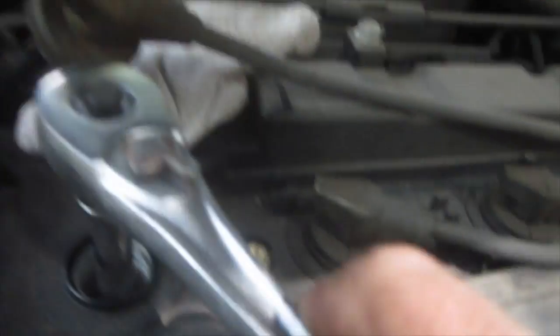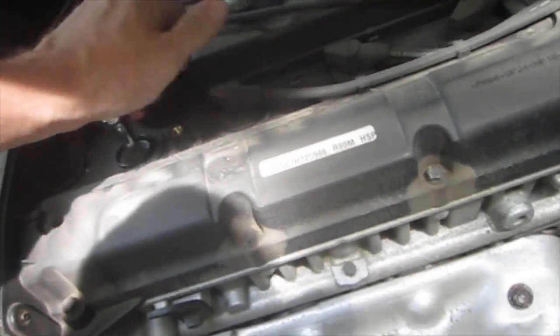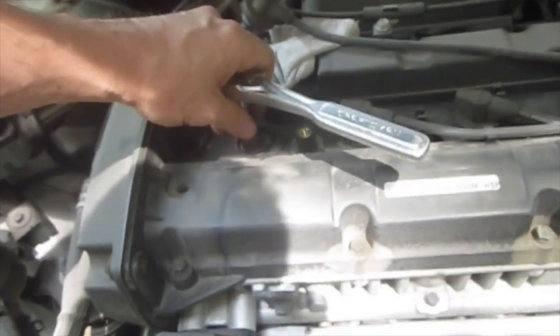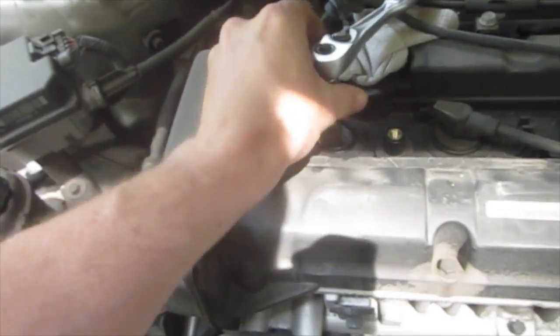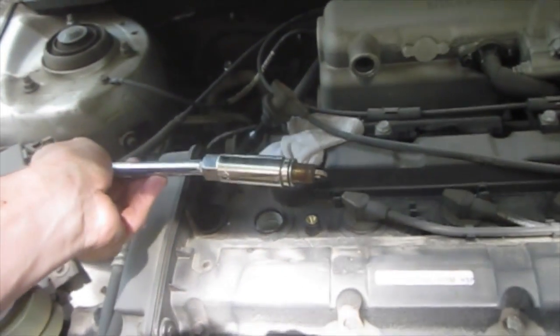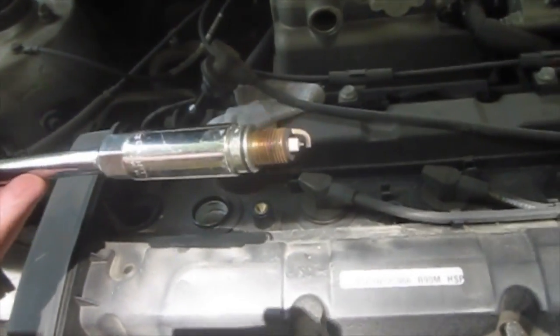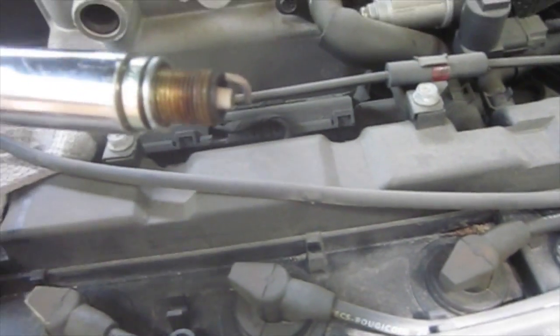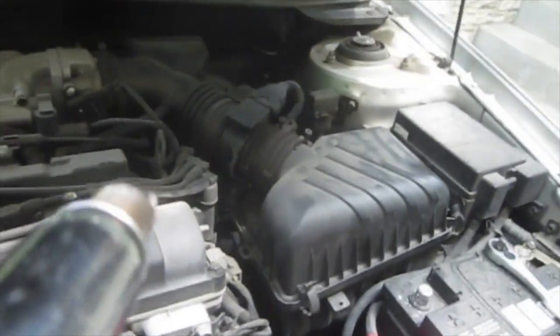I'm going to release this plug here — it should turn fairly easily. I had to give a little bump with the palm of my hand, but that's all it took. You shouldn't need to put any extra torque on it, just spin it until it's loose, then it should come up and out. The spark plug socket also helps grab the spark plug in addition to keeping you from getting shocked. My plugs actually don't look that bad, but this car — even though it only has 43,000 miles — I don't drive that often, so these plugs have been in for almost five years. The plugs will be hot if you were just driving, so take a little rag, pull it out of there, and set it aside.